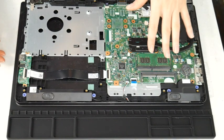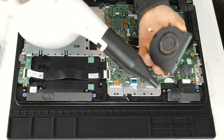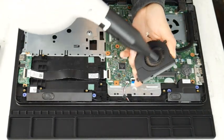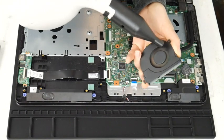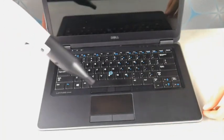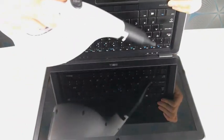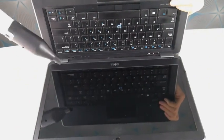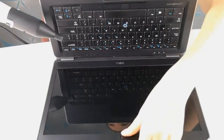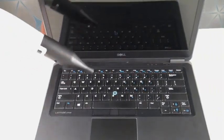And I'm doing all this while unplugged and not powered on. And also when it's done, I'm going to take my Air Cannon and clean anything that could possibly be wet from my cleaner or from the spill, because I don't want any sort of liquid. I'm going to do any part of my computer that could possibly be wet, because the goal here is to have it be dried, and if there's any liquid to clean it off — because that's what fries your computer: dried-on liquid or wet liquid on components that are not supposed to be on there.